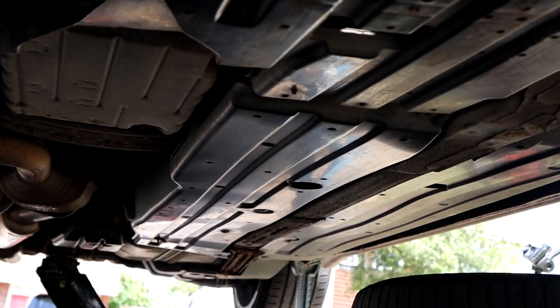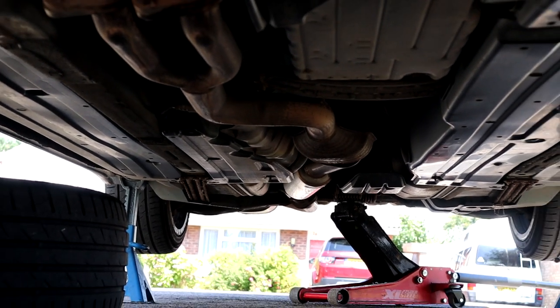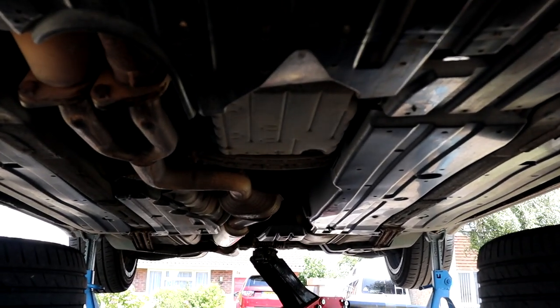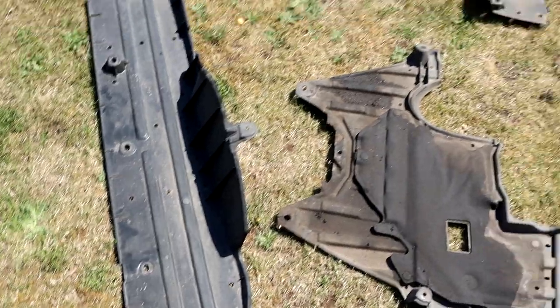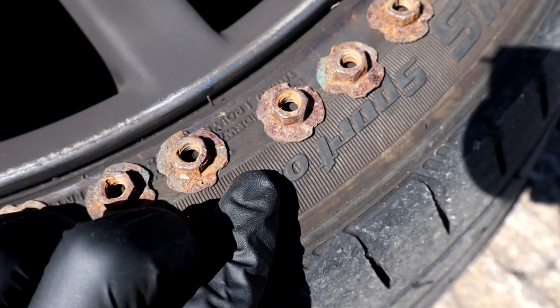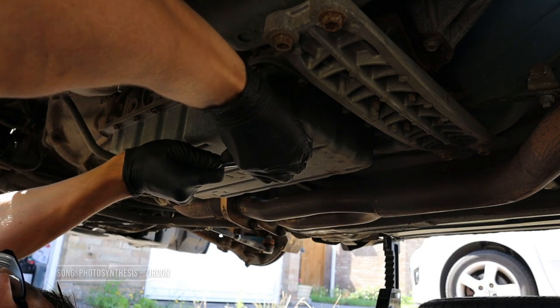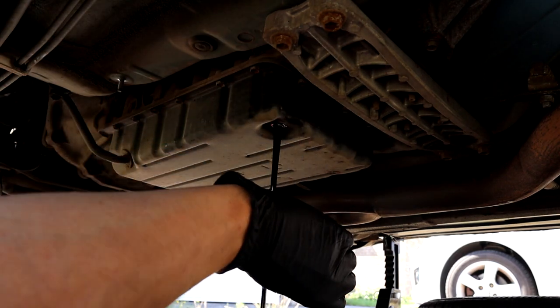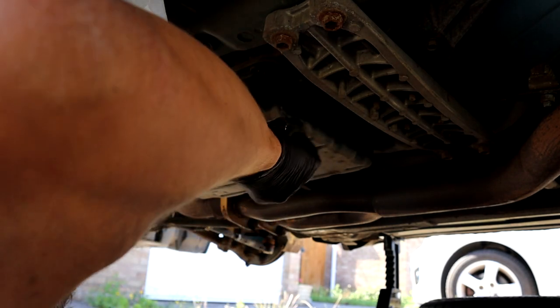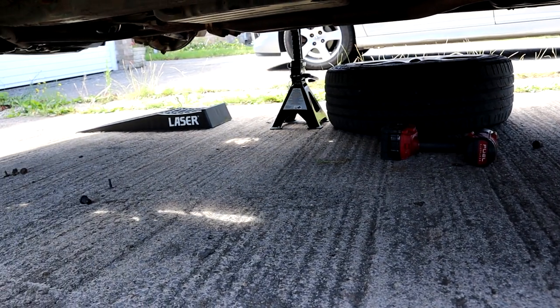Now I'm going to take the covers off — there's one right there, one here which is the second engine cover, then a heat shield, and I'll probably have to disconnect the exhaust. I'm not going to film the cover removal since it's simple stuff. I've got all the covers off. I just want to show you this — one nut was behind a plastic cover and was exposed to the elements. Look at what UK weather does to cars. Let's drain the gearbox — it's 14 millimeter for this one.